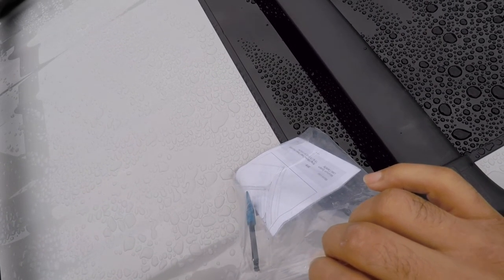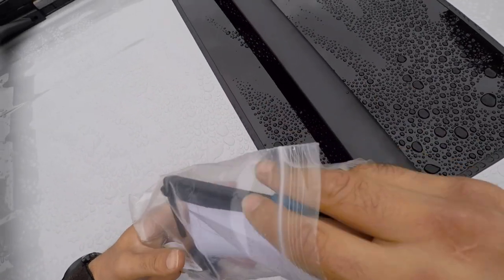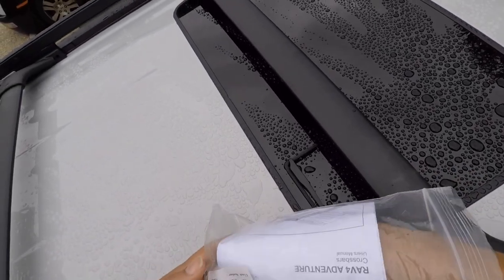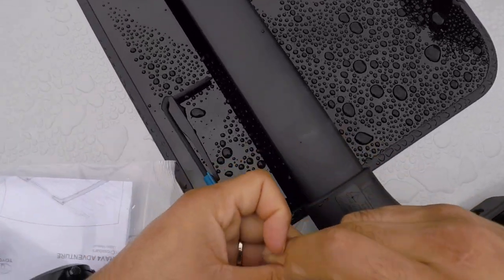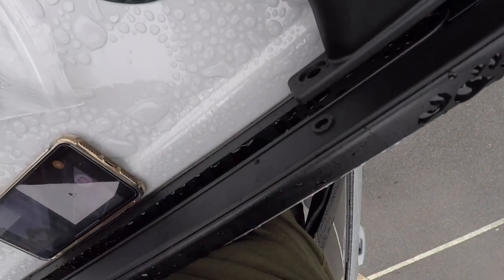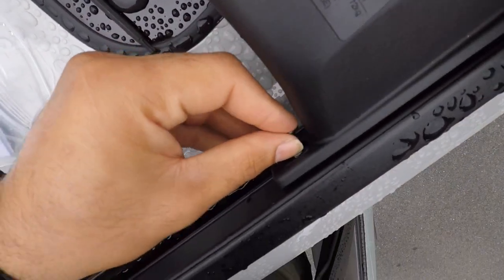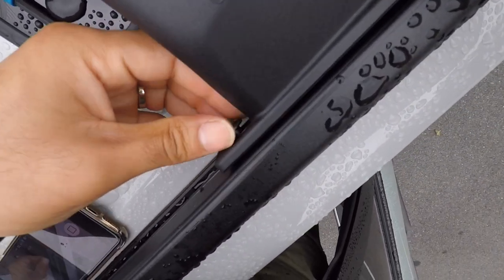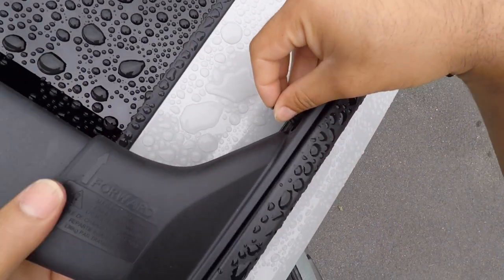Here we're going to take all the hardware out of the bag. When you put these screws in, make sure you hand-thread them first. Also, make sure you clean the hole where the screw goes into — right now there's rain or water on the vehicle, so you want to clean that up before you put those screws in. Because if you don't, in the long run rust is going to develop, or some kind of corrosion is going to happen and those screws are not going to come out easily. So just hand-tighten these in there.